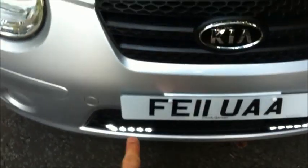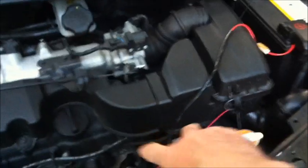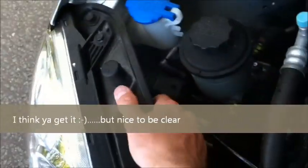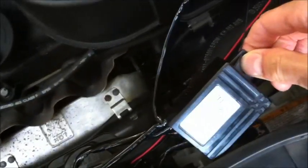This works in conjunction with the controller to say: when I turn the side lights on, turn the DRLs off. So positive, negative fused to the controller, then positive, negative out, with a wire into the light connected to the positive connection of that light. So when I switch it on, it signals to the controller to turn off the DRLs.